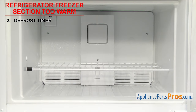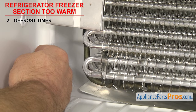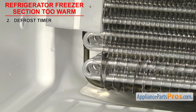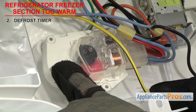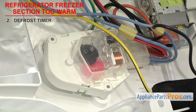In order to tell if the heater is working, you'll have to access it behind the back wall of the freezer. After about 1-2 minutes, you should be able to feel the heat from it. If the heater doesn't come on, do the checks for the heater and the thermostat in the upcoming sections. If those parts check out okay, that usually means the contacts inside the timer are bad and won't send power to the heater. If the contacts are bad, then the defrost timer will have to be replaced.